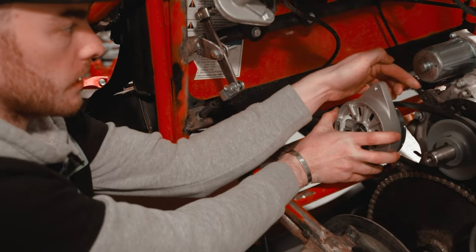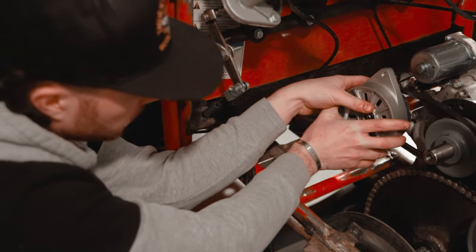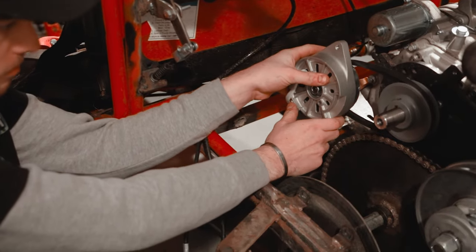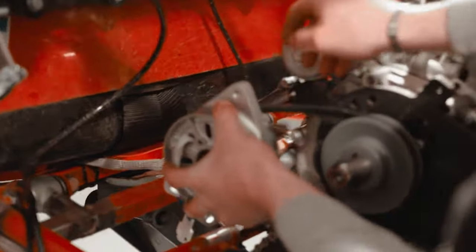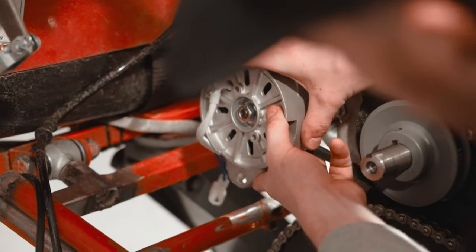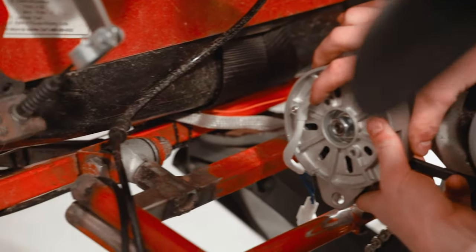I'm gonna weld the bracket that comes off of this, weld right to the actual Go Power Sports 40 Series plate, make a little tab down here, maybe with a little bit of adjustability so we can tension the belt. We are running really close to the chain, but it's fine. And we may go to a smaller size sprocket eventually anyways, but that gives us enough room off the sprocket. Probably get some angle steel in here, make myself a nice little bracket. This is all gonna be pretty well hidden, so I don't care about it being crazy pretty. Make another little bracket down here, maybe with a little bit of adjustability so you can tension this thing. We're gonna be in good shape. Let's get to it.